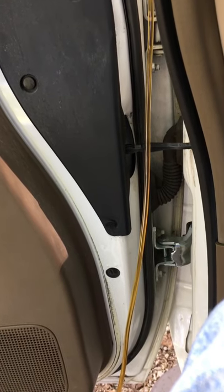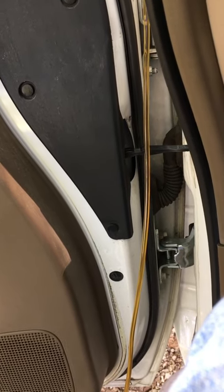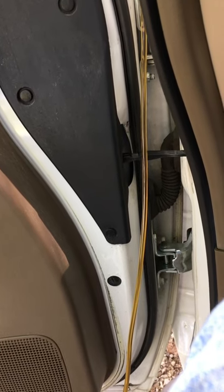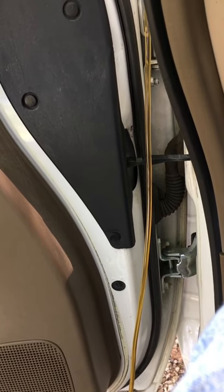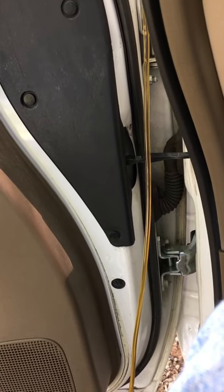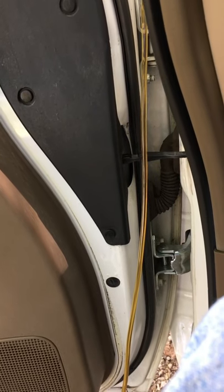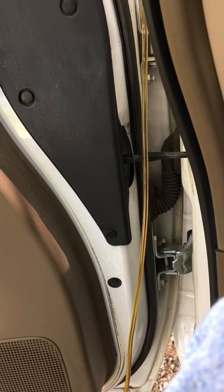Go back, tighten your bleeder screw — like I said, don't get stupid with tightness, just snug it down. Put everything back together and make sure you torque your lug nuts to the manufacturer's recommended torque in a star pattern. I always re-torque, and don't forget to recheck your lug nuts especially with aluminum wheels. The recommended interval is after the first 50 miles. That's basically it guys — I'm going to pump this thing about 10 more times, put her back together, and then it's lunchtime. Thanks for watching.